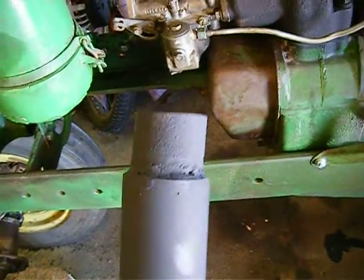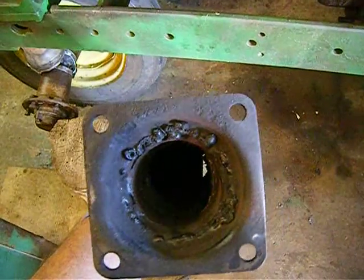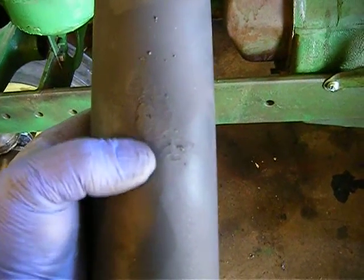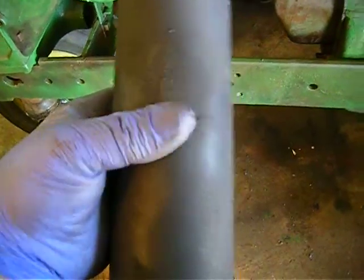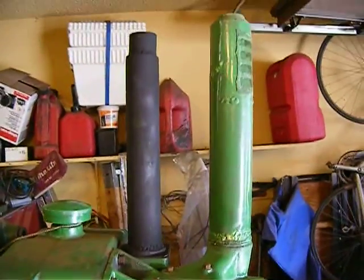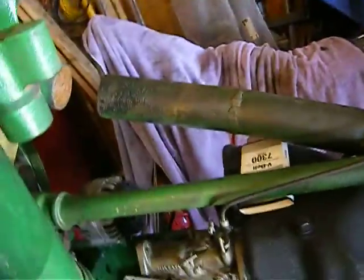I made a pipe — there's the top of that welded on there, and I just kind of ground it down a little bit and painted it black. You can see the insert in it. When I got it done and I thunked it on something, it rattled. So I just took my arc welder, looked inside there, and ran a bead of weld right there, then ground it down. I went really deep with the weld so it went through into the part that's supposed to muffle it a little bit — the inside of it. It's not absolutely perfect, but I know it'll fit under my garage because it's slightly shorter than the stack. It might not be absolutely factory perfect, but it'll serve its purpose.